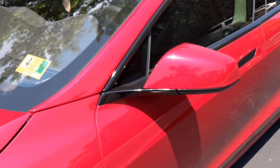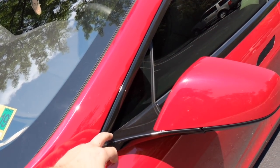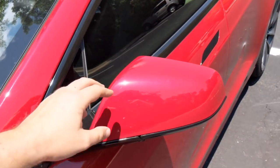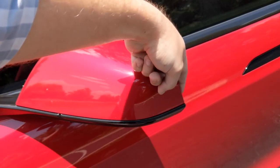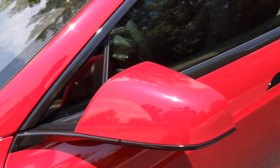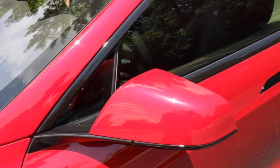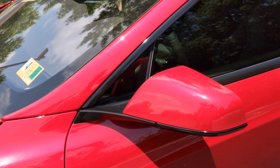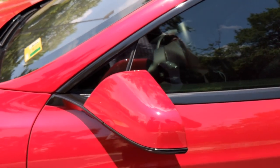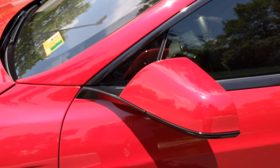Now to the mirror. I did this with the mirror section on but removed the movable section of the mirror. To take off the mirror cap, start with a pry tool under this edge here and pry all the way around — this entire thing pops off. I was unsuccessful doing this without breaking off one little tab from the top right — it's a very flimsy tab. I was unable to do either one without breaking that tab, but there's no issue with security even with it off. It's still very secure with the remaining tabs. Take off this cap and you'll see three screws coming down from the top into this separate piece.